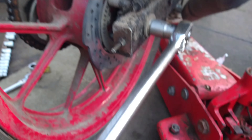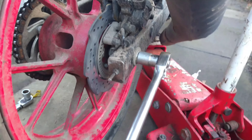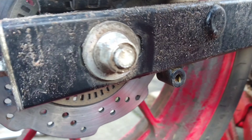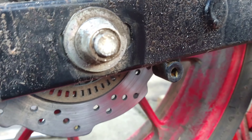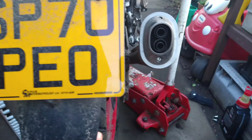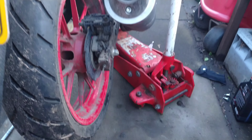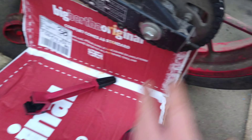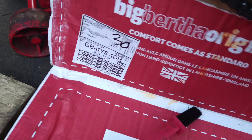I've got the 17 and the 19 - I've loosened it already. Now I'm going to adjust it up equally on both sides of the screw and you'll see it on there. It has to be the same gap on both sides so we know that the wheel's straight and in line with the bike.